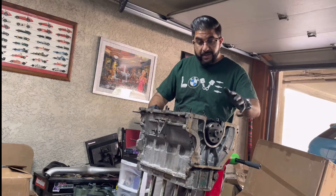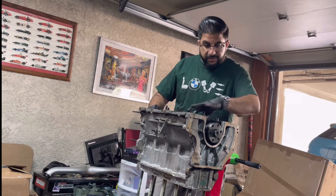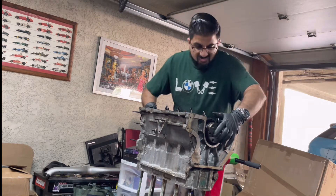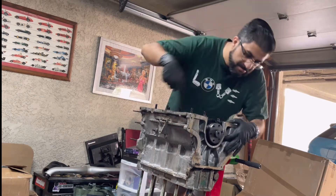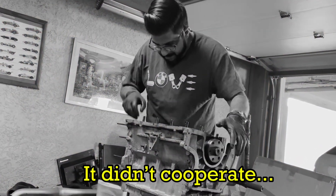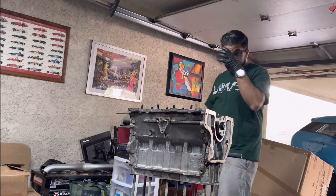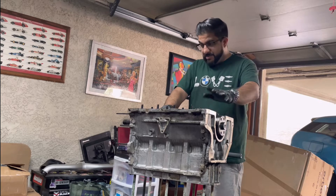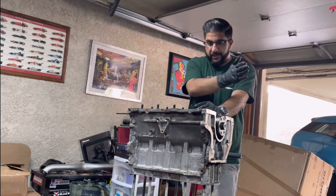I figured I should bring you guys in. I have that last main bearing cap off and two of the connecting rod caps off. These other two are not quite cooperating, but I'm thinking if I can pull the crank out they'll cooperate. Alright, let's see. Crank removal, take three. Bearing number three... bearing number four - I think it's four. I think you go this way, so number four.